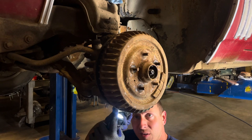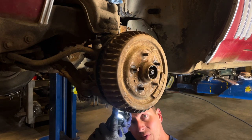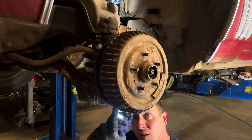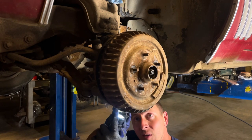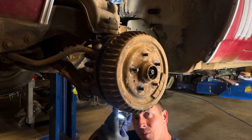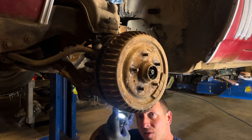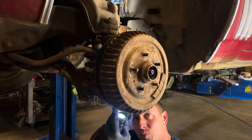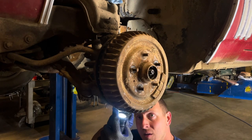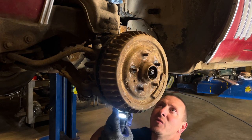One of the springs that retain the brake shoe has come off, and it's just laying down here, jammed between the adjuster and the rubber plug. Okay, it's turning. I sprayed the crap out of it earlier, so I'm just turning the adjuster wheel, which I'll show you as soon as I get this off. So it's taking the pressure off my pads. Just gonna back it all the way in. My drum might just fall off of my head here in a second.